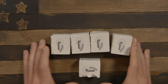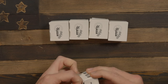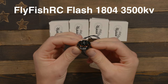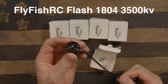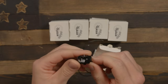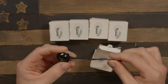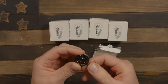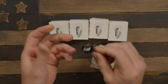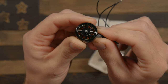Next up we have our motors — these are again FlyFish RC, recommended for this frame. This is an 1804 3500 kV. These are a little bigger than you might want if you're trying to stay sub-250 grams. A lot of people go with a 1404, but I wanted that extra power so I went with the 1804. I think these will work out really well and I like the way they look.